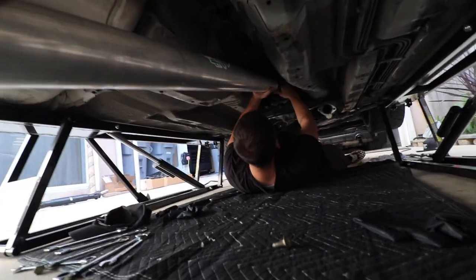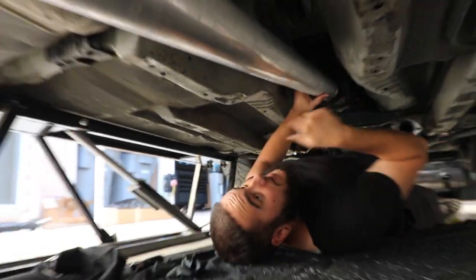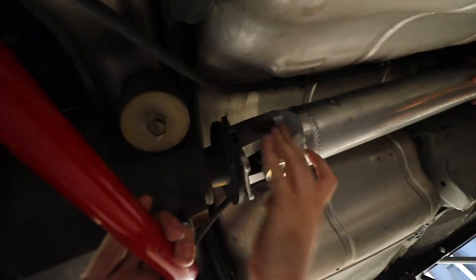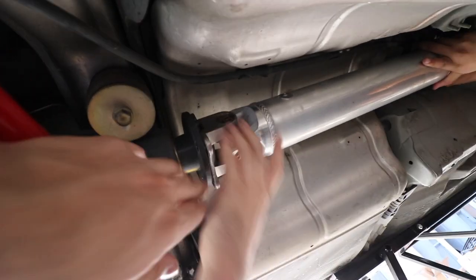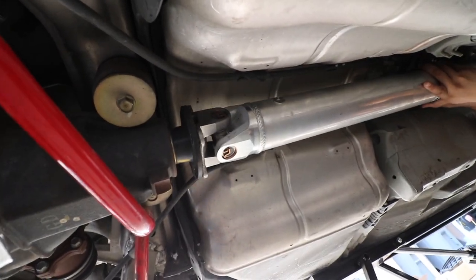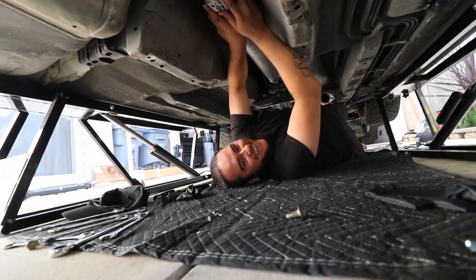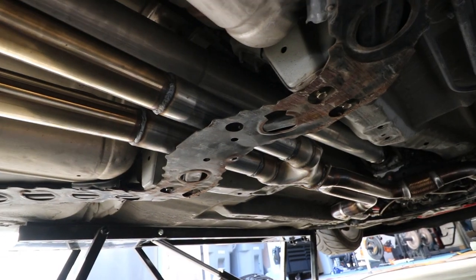First thing I'll say is I've been telling Martin to get rid of those heavy doors. To install the new driveshaft, you want to line up the teeth inside with the transmission — there you go. You might have to move it a little to seat it. Since it is a new driveshaft, we're going to mark it so that if we ever take it off we put it back in exactly the same spot to keep it balanced.